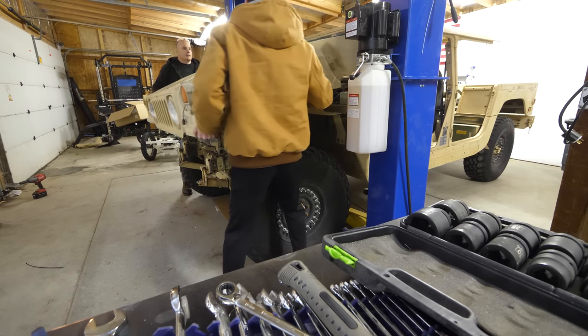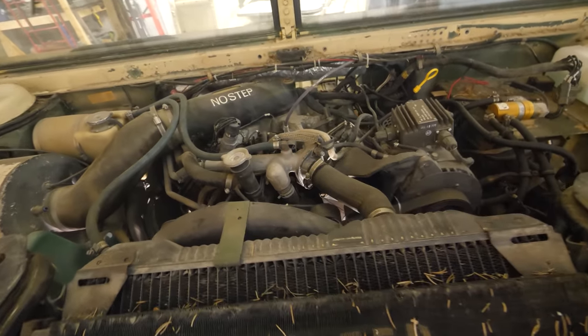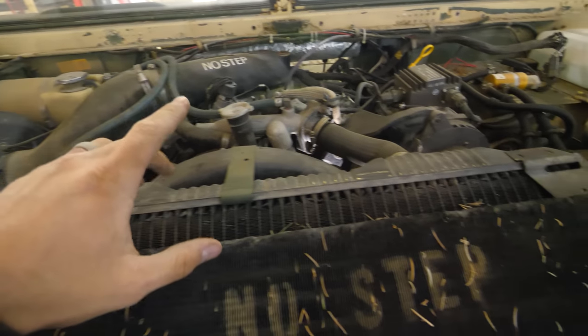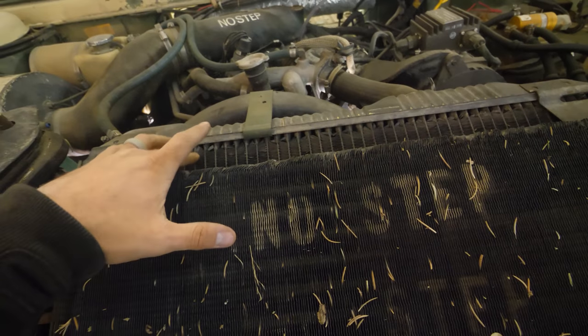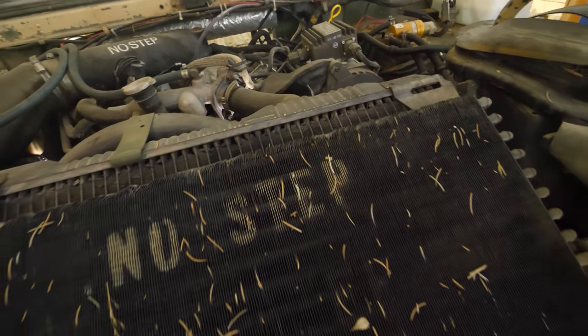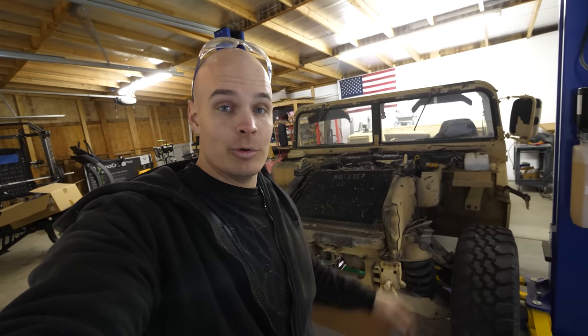Now the hood is off. This thing looks like a beast. A combustion engine has so many moving parts inside. Like when we stick the electric motor in, it's gonna be so much simpler. But one thing that needs to come out first is the radiator. The problem is that this radiator is full of a ton of liquid. And that liquid's coming from the reservoir, from the top of the engine. It's all over the place, and if we don't drain it, it's gonna leak everywhere when we start removing parts.